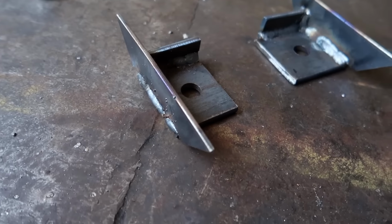With the last of the plywood attached and the floor back up on its side, I finished filling each of the voids with foam. After trimming the excess foam and getting the floor bolted back onto the subframe, I used a flush trim bit on the router to trim the floor down to the exact size and shape of the subframe.